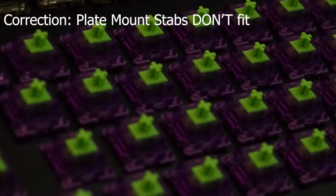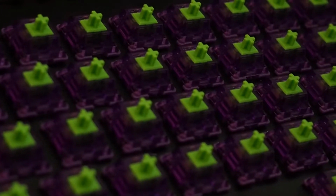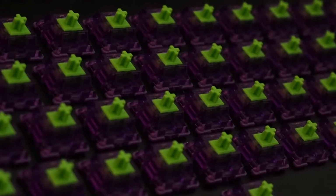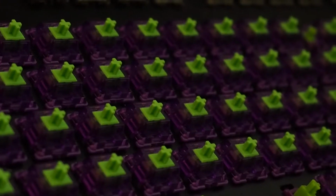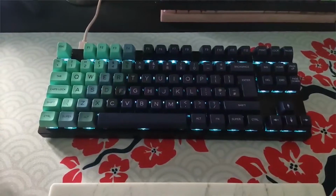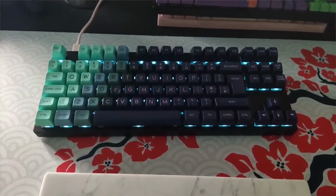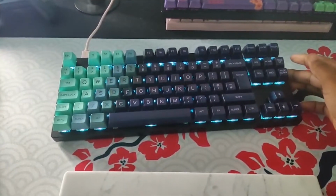Real nice. The integrated plate design is a low-profile board that features a footbar that screws into the base plate with 3 M4 screws, making it a natural typing angle of 8 degrees. It is a comfortable typing experience with or without a wrist rest. I currently use one of the rubber strips on my CU80 on the front base in its mark groove, but I've heard of others using the extra rubber strip along the center of the footbar to give it a little extra grip. I didn't want to change the typing angle of my board, but as you can see, having only one rubberized point does cause the board to slide around a bit when pushed from the bottom or either side. However, this is completely a non-factor in daily typing or gaming use.